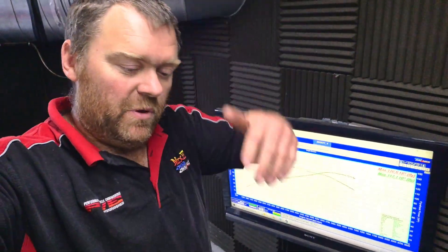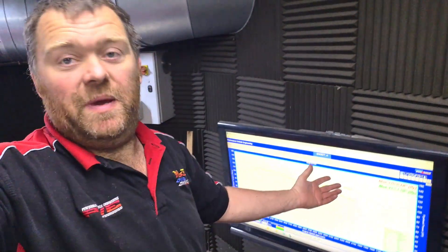Happy days - what a lovely little car. Didn't put a foot wrong on the dyno and it has made 116-117 horsepower, quite consistently. Those engines are rated at 82 horsepower. It's got a different inlet and exhaust manifold and that's released quite a bit of power - I'm quite impressed. I've revved it a little harder than stock, hitting the limiter around 7200. It's not making power there anyway. People online say they go to 8000 but I don't see much point - the power curve's falling off. Another nice little job, nice little conversion, all sorted.